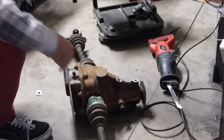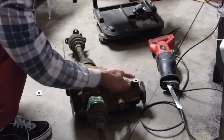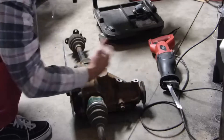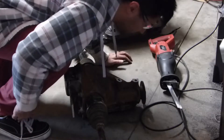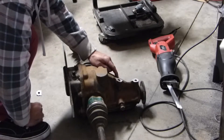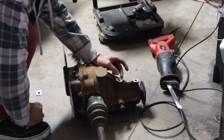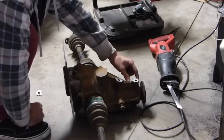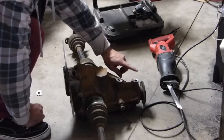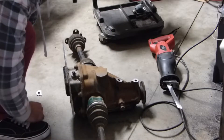That was a lot of work. The whole point was it was actually hitting part of the subframe, so it wasn't able to lift up high enough. And this was also going to hit some of the transmission tunnel, so we just cut it to get more clearance. We can still put quite a lot of threads down in here with a bolt and just use some sort of angled washer, but it's so close to the subframe I wanted extra clearance. Same thing here, which sort of sucks — where it hits on the transmission tunnel, I won't actually be able to put a bolt through there anyway, so those will be totally useless.